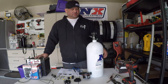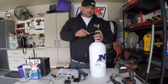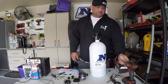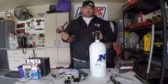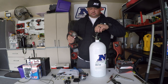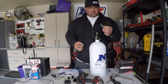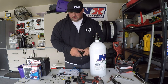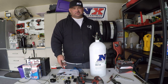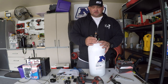I've got a battery set up so we can test it to make sure it works. Your first step is you have this little cap here that covers up the nut, so you want to pry that open real nice and easy. Take your half-inch socket, take the nut out, and the handle will come off. Keep that — you might want it whenever you go to refill the bottle. Notice this thing is a little square so it can only go a certain way.